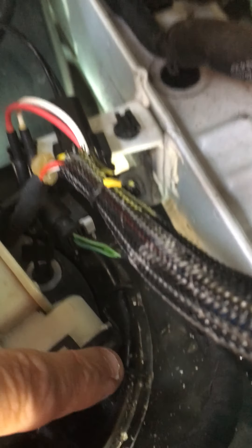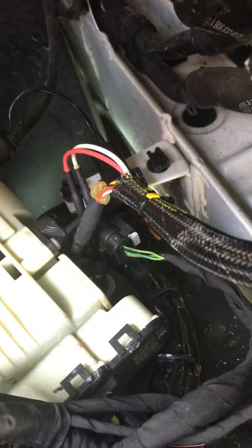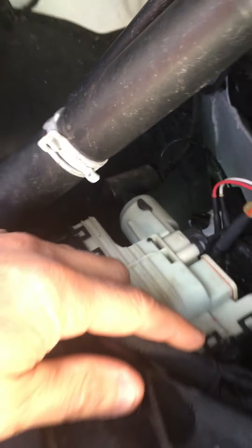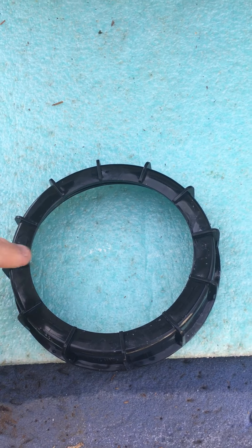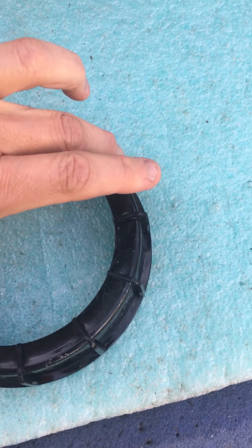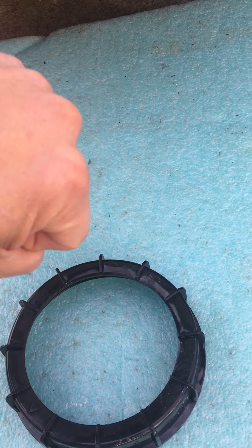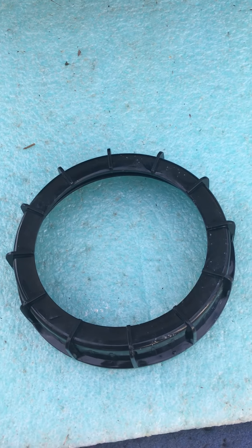Then there's a locking fuel ring right here, and there's a special tool I ordered on Amazon — it's made by KD, or Lyle makes a similar one. That tool prevents you from breaking the tabs off when you try to unscrew the ring. When you order the new DEF heater assembly it will come with a new lock ring, but the special tool has locking tangs and a 3/8-drive top so you can put a ratchet on it to loosen it easily.